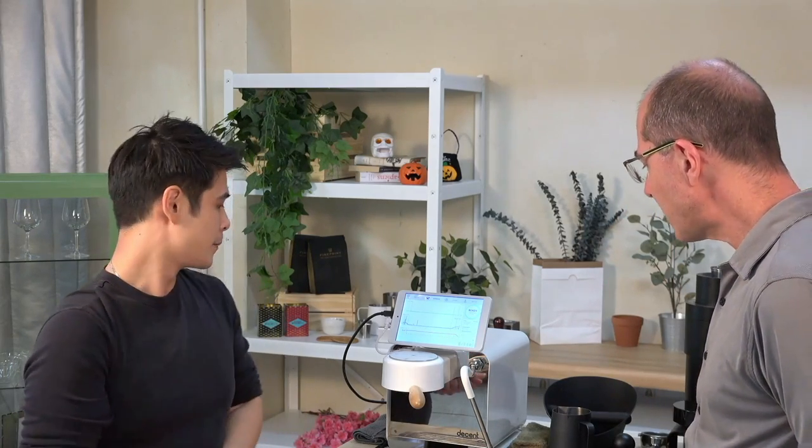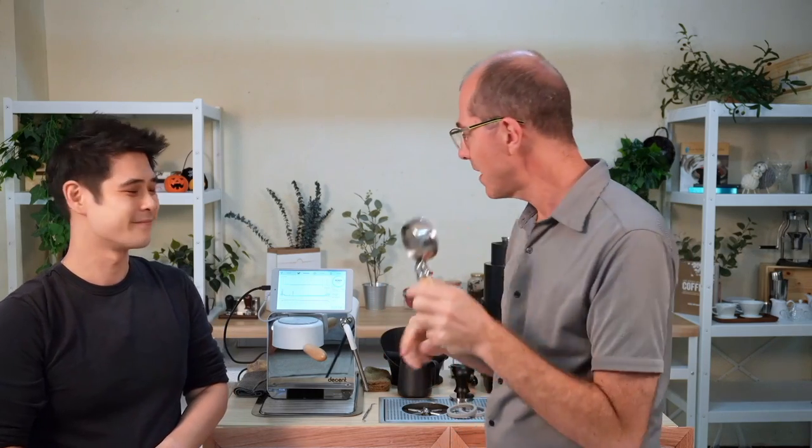A clue to know roughly when the gasket is about to fail or is leaking is the final resting place of the portafilter handle. A decent gasket will lock anywhere around seven o'clock on the group head. If we think of the group head as a clock dial, seven o'clock or half six is fine. Anything beyond that point, combined with seeing beading, is pretty much a sure sign you need to think about changing your gasket or giving it a clean.